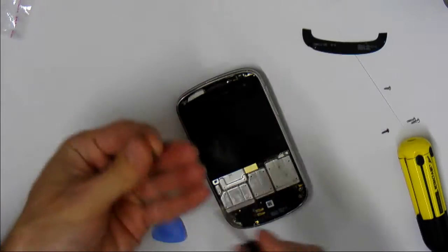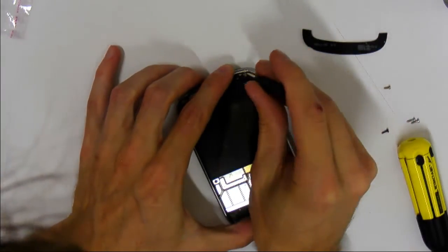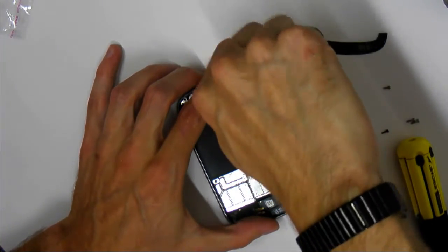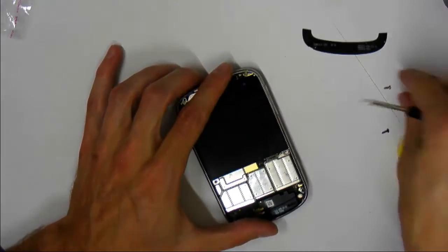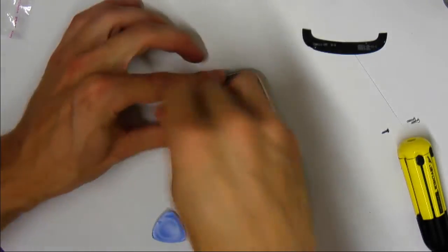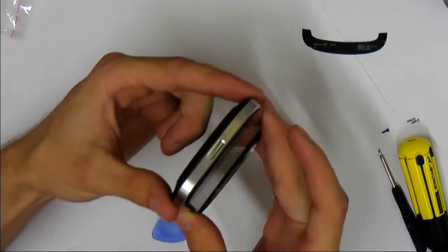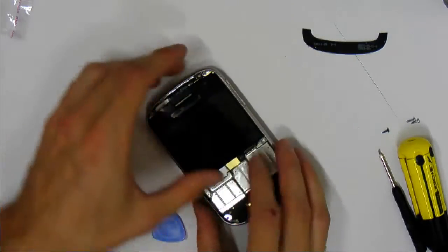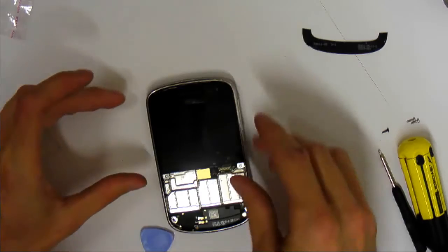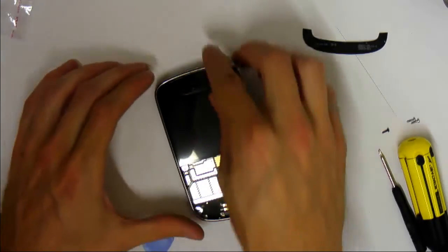So we'll start with the gold screws. Those guys go on the top right here, and you'll feel the case tightening on the back as you tighten these guys. Don't tighten them too much, you don't want to strip the threads. But it's tight enough, the case has come together nicely. Now you can push the screen back. Push down a little bit before it'll go back all the way.